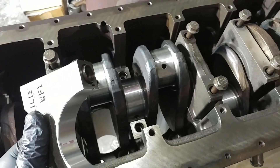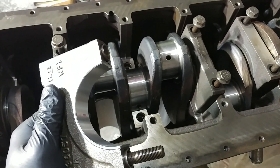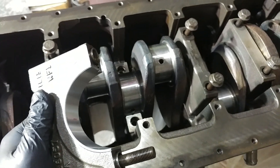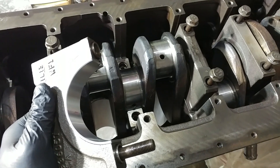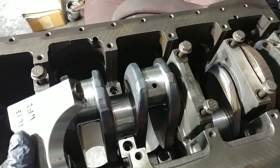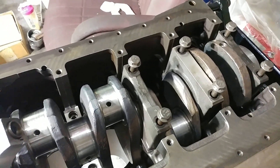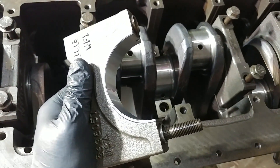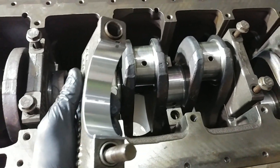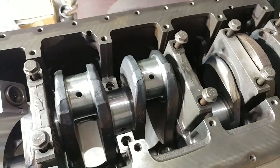It looked perfectly clean. These main bearing caps look clean. But once you start washing them down, you'll see a lot of debris — fine debris — debris that you don't want in your bearings kicking around. There's plenty of that other stuff that's going to happen just on its own. We don't need to be sloppy and introduce it by human error.